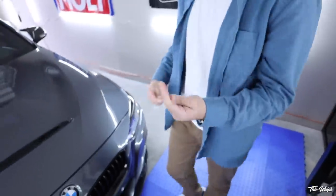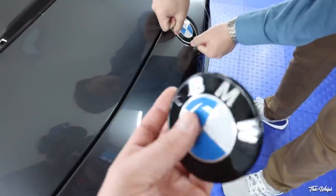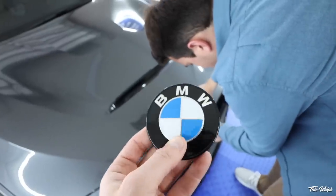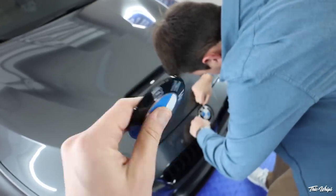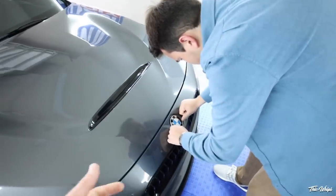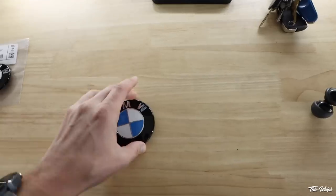While he's doing this, he's going to work behind the badge here — just remember to pull up while you do it. The new ones that come in when you guys order them do come in the actual OEM bag with the part numbers and everything, and it has the 3M already on the back. This is a brand new badge from BMW that is sanded down and then we put our templates on, paint them, and re-clear coat them — so it's like having a factory OEM badge. You can also use a trim tool to help speed up the process if you need to. Just make sure if you're using a trim tool to put a rag underneath by where the paint is so you don't scratch it.